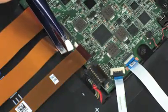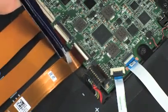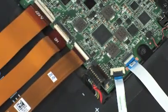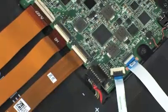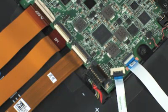Insert the rear-facing webcam ribbon cable into the rear-facing webcam ZIF connector on the Slate system board and press the locking bar down to lock the cable into place. Caution: use care to prevent damaging the ZIF connector and ribbon cable.